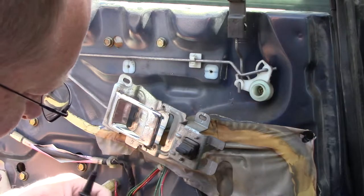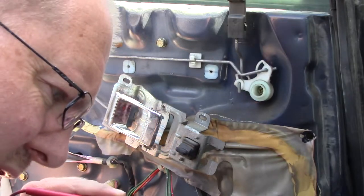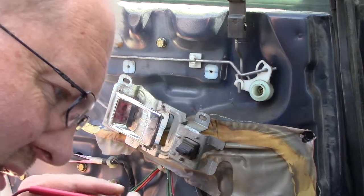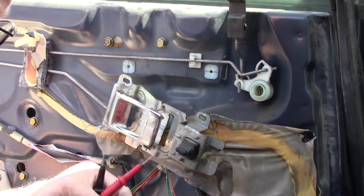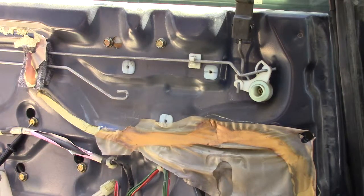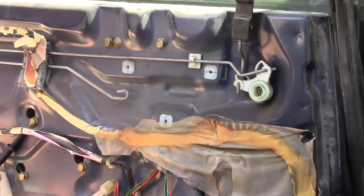So that one's green, green with yellow, green with black. There is power — 12 volts to that one — that's good. I think I've got a short on either the green or the green-yellow, because I'm getting power on one of them and the one that's supposed to be grounding out isn't. Let's get this fender off and see if we can find any bad wiring inside there.